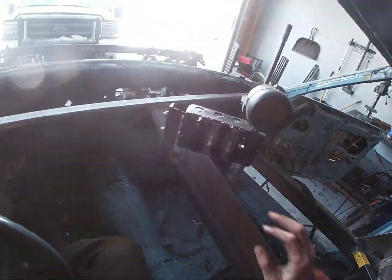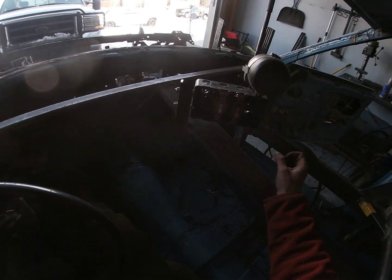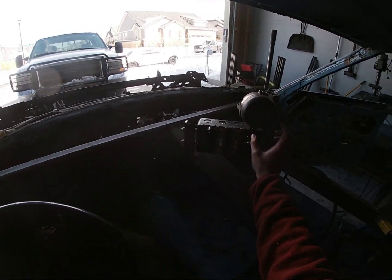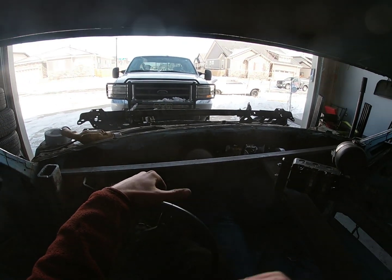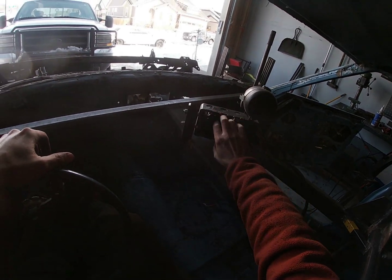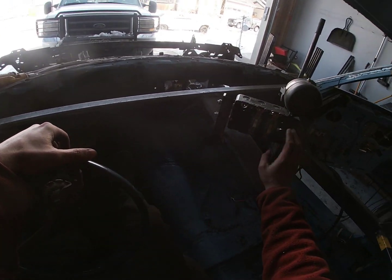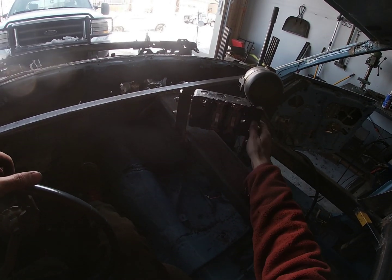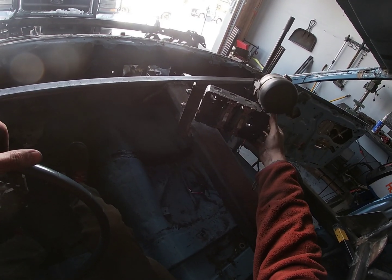Okay, she's all welded in. Ooh, that's a little hot there. So there she is. So push button here. I can see my tack. I know it's a little backlit probably, but I can see my tack right out of the corner of my eye without having to move. Got all my switches nicely within arm's reach, including my push button. That one's really important. And it's a little goosey there, but that's not bad. I mean, that's what you can expect from a little metal gang box like you get at Home Depot like this.